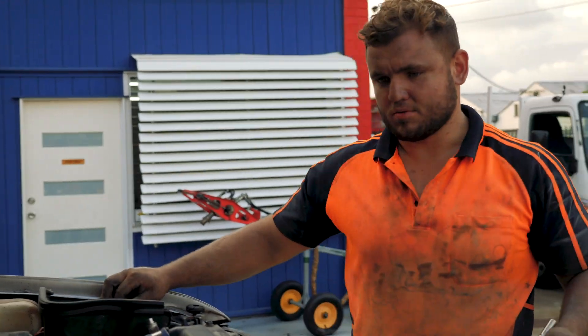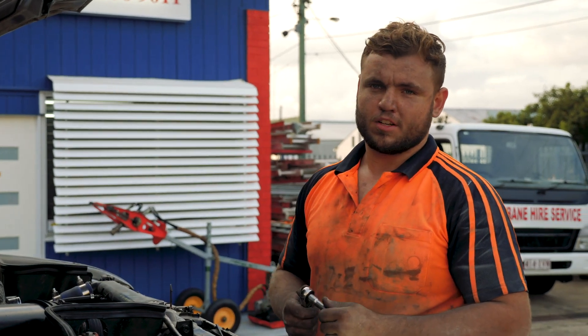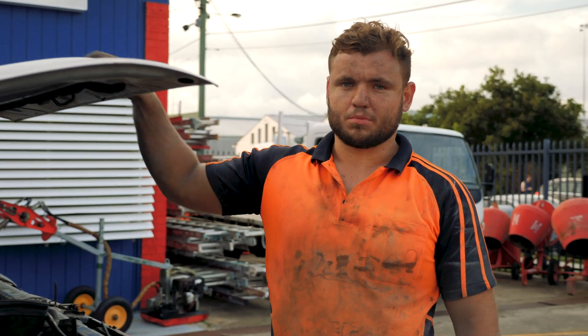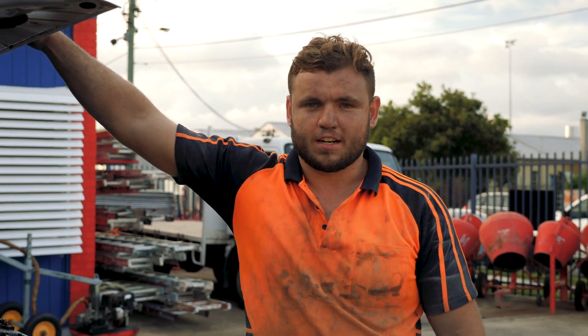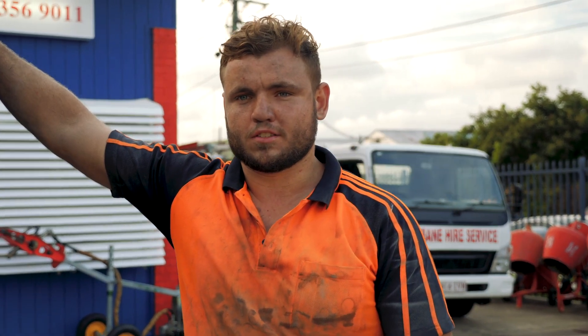Day two prepping the 80 for paint. Nathan's just going to rip all these trims off now and he's actually bumped up his budget for the paint a little bit to six hundred dollars, which I think is a bit more realistic. That includes all the parts, all the bog and sandpaper, and the bloke to paint it. He's also trying to sort out a fuel issue — getting a bit of a fuel cut when he revs. He's got to reset the computer because the intake was sucking shut and put it into a fuel cut mode. A little hack: instead of waiting half an hour for the computer to reset, you just turn your lights on, pump the brakes a few times, it drains all the power out of the loom, wait 30 seconds and it should reset.